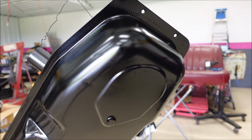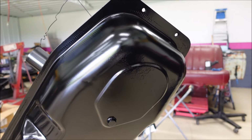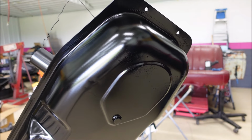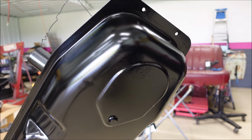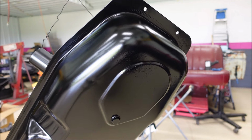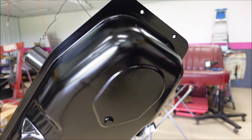I was painting and it was hot. I used reducer that was medium and I used too much of it. So the sealer was going on very, very dry. I poured it to it so that it would lay down flat and smooth, and it did. The sealer looked really nice.